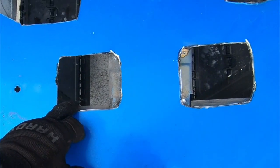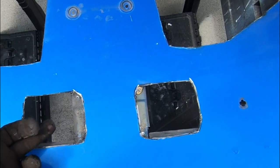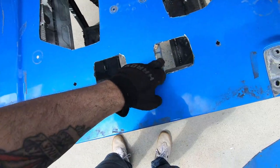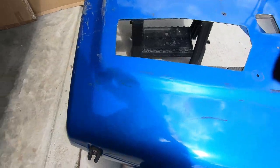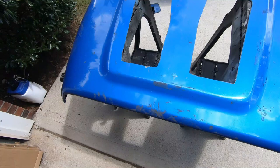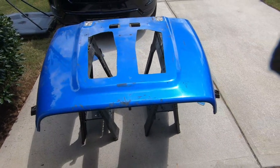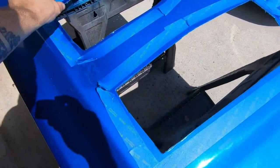And these back vents, just be careful cutting them out because the support on the underside of the hood runs right under where you cut. So just do real thin cuts. I cut the outside edge first and then flipped it up because you just don't want to cut through that, obviously. So I'm going to clean up all the little cuts, little holes. We'll spray a little paint on them to make sure we protect it from future rust. Then we're ready to lay the louver on and mark, or drill all of the holes to mount it with the hardware. Top side and underside both painted now.